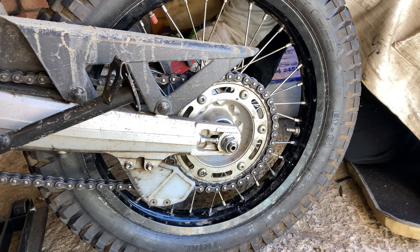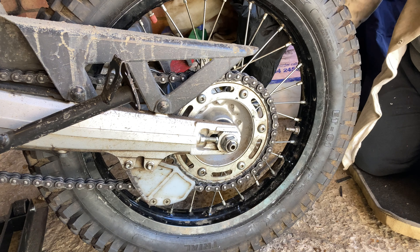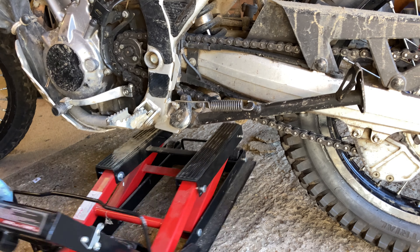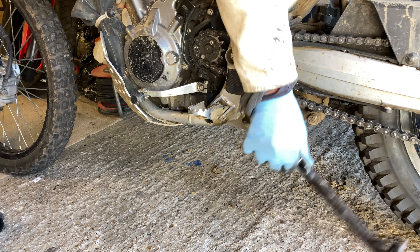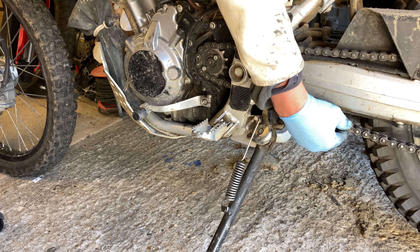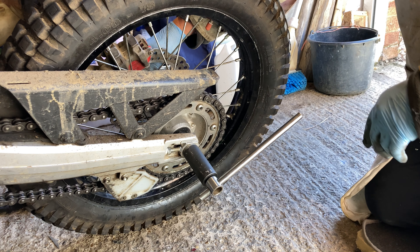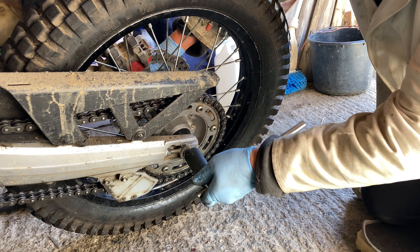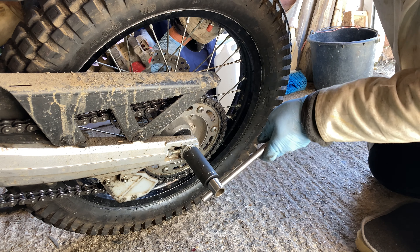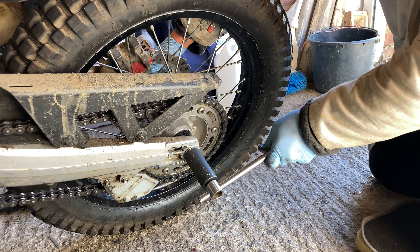The amount of people who wring these nuts up — they don't need to. And I'll show you how we check the adjustment. If you put your weight on the bike, that's not far out. Remember, it's better to have it a little bit loose than a bit tight. Tighten your wheel up — it's a 17 and a 24. I've got the aluminium spanners in my tool kit, but I don't want to keep getting that out. Job's a good one.